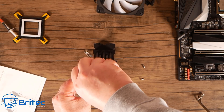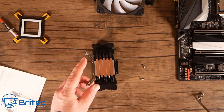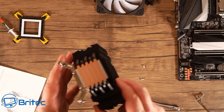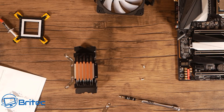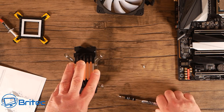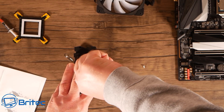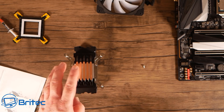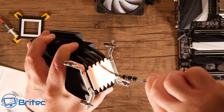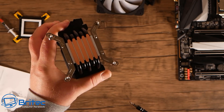The good thing about this cooler is it's an addressable RGB cooler, which means it will sync with all of your RGB on your board when plugged straight into the motherboard. We've got the two screws in now — just going to get the other bracket on the other side, repeat the process, and that's the bracket done. Then we can put some compound on the CPU and get it screwed down onto the motherboard once we have the back plate on. Make sure you don't over-tighten, and there we go — bracket is on.